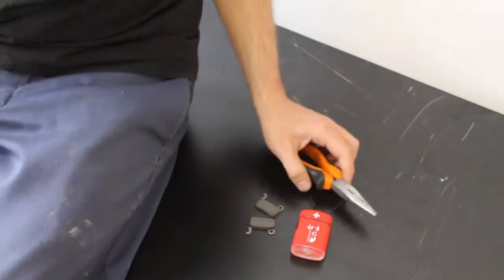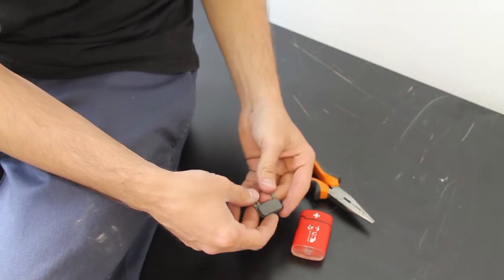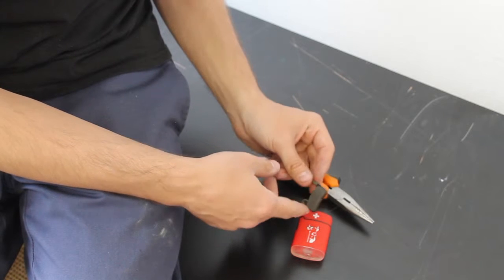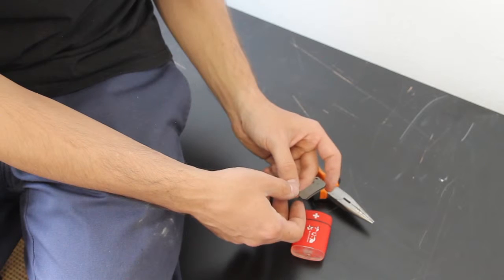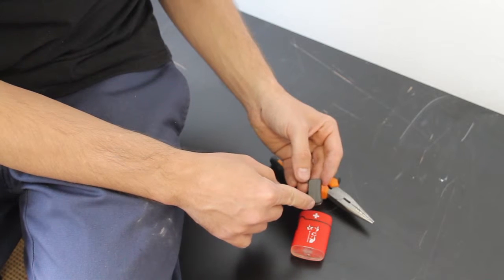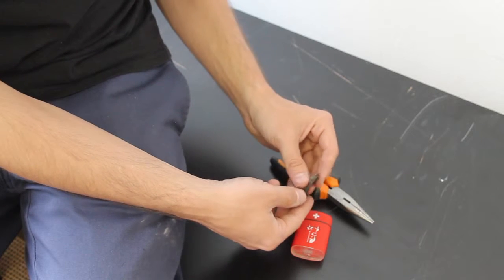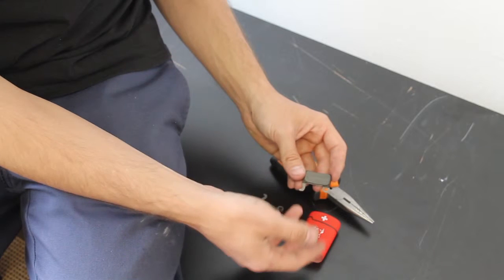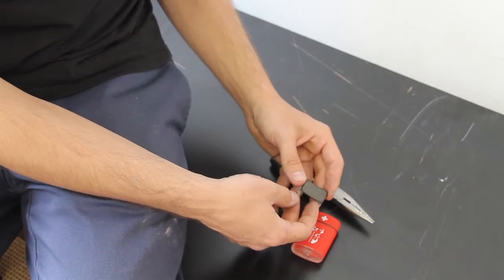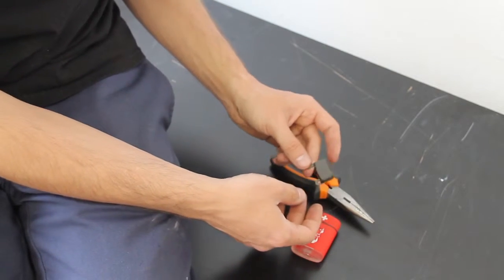I had read that the biggest reason for brake squeal on a mountain bike is contamination — some kind of oil getting on the pads. These were completely soaked in oil as you saw in part one. One thing you can do is try to heat the pads up. They're a porous material, meaning when they get soaked with something it absorbs in. Heating with a lighter might drive the moisture out, though most of the time you just need to replace them.